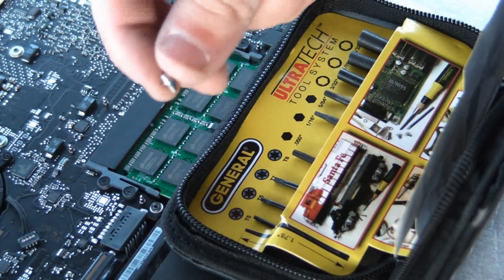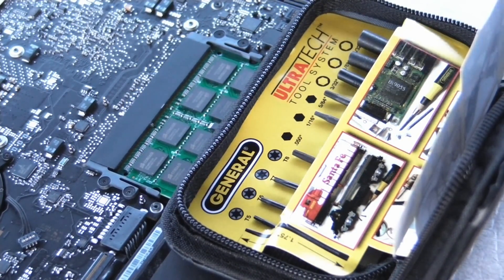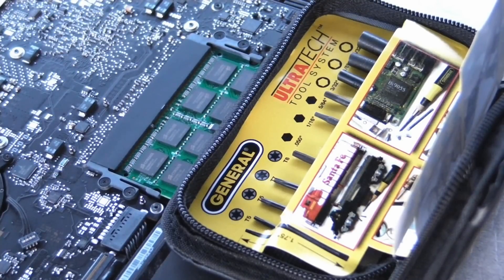Five hundred gigabyte hard drive — here's the screw. There are four screws, you gotta unscrew them all. Let me explain why I'm not putting a one terabyte hard drive in the MacBook: the thickness of that hard drive, 2.5 inches, is 12.5 millimeters high, and basically it's not gonna fit in the MacBook 2010 White. So I didn't want to take a risk and I went with 500 gigabyte, which has the regular thickness, the regular height of the hard drive, and it perfectly fits in the MacBook 2010 White.